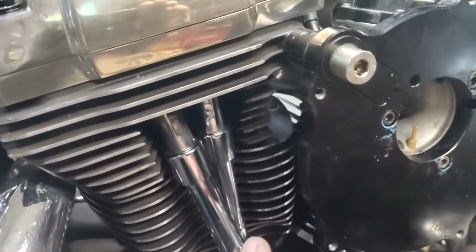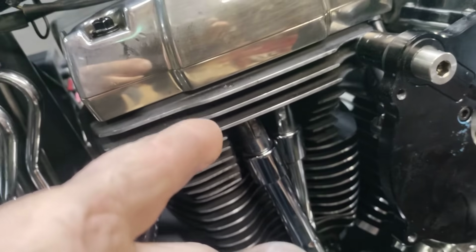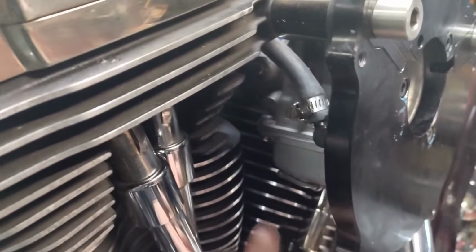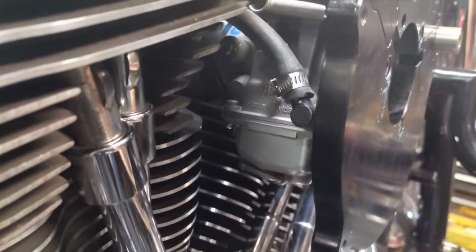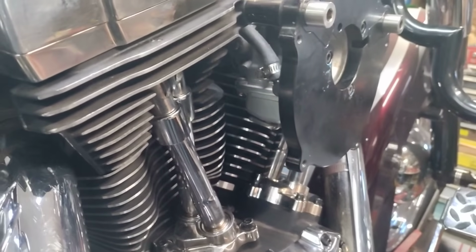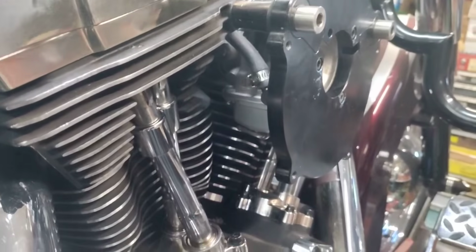So when we started it up, now there's a fair amount of oil, so it didn't start right off the bat. This is the one we changed from fuel injection to the carburetor. I put I think a 50 pilot jet, but I tried to adjust the low speed or the air mixture screw on the CV. It really didn't do anything, so I think the pilot jet's too big. So if it's a 50, I'll go to a 48. If it's a 48, I'll go to a 45.